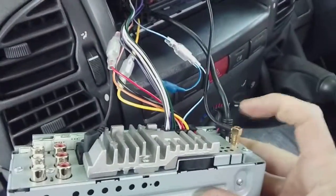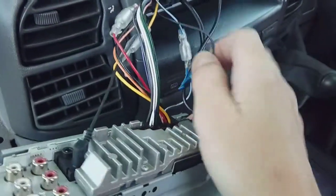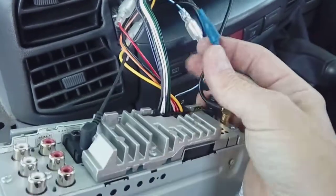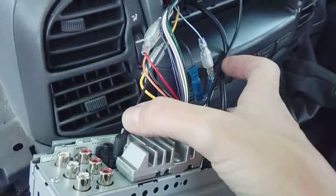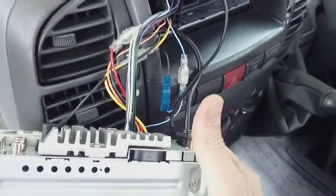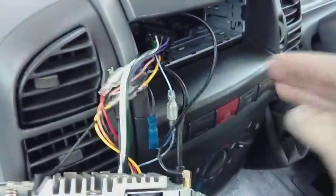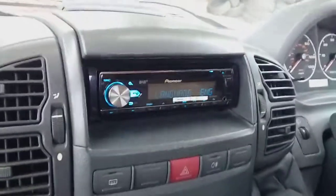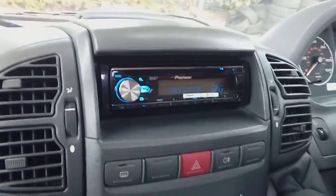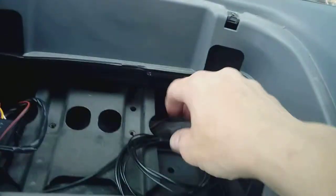Just before I shove the radio in — we've got the DAB aerial plugged in, normal aerial plugged in. Because it's a powered DAB radio, there's our black wire that we ran from the antenna to the blue wire which outputs power to the DAB antenna — crimped in. Microphone plugged in and our main power cable plugged in. When you push the radio back in the slot, make sure you don't trap anything — pull it through as needed, tuck it down into the little recesses in there. And there we go — radio installed. Tidy up any loose cabling.